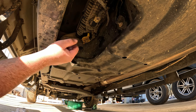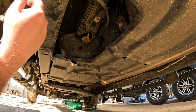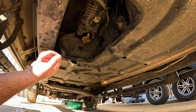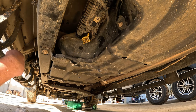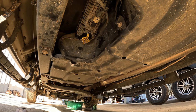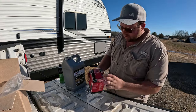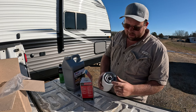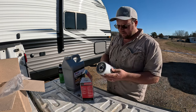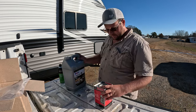I do like that part about the newer stuff — I don't like having to bleed anything. Okay, let's get back up here and put our engine oil filter back on and put the plug back in. Now, when you've got these upright oil filters like this, first things first — take it out and make sure you've got that seal. If you don't have that seal or something looks dirty, don't use it, stick it back in the box.